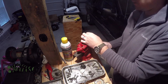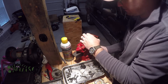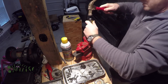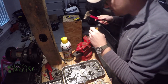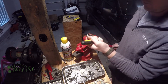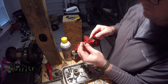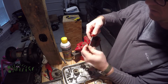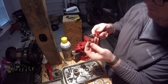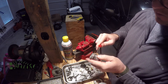This one is somewhat the same way except you may have to gently seat your clamp a little bit. That one was a lot easier. Now inside your brass bushing you just have a little rubber seal - take a pick or something similar, pry it out. This is what you're going to replace. You'll probably need to clean up in there as well. Another part you've got to remove is the old o-ring seal.